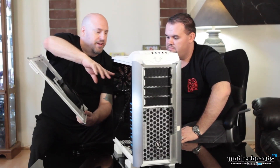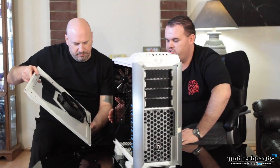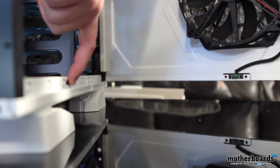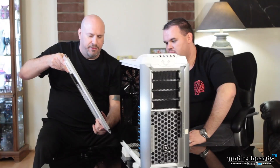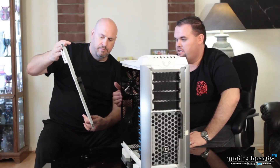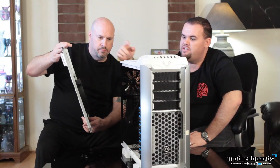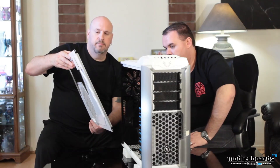That's pretty cool. So no more little wire cable running from the back of the case into the fan giving you problems. It's pre-wired contact — as soon as you close the side panel, the side fan starts going. You can see right here the contact point on the case where it makes the connection. So when you close the case door back on, you've got your fan working. Now, is this fan taking air in or air out? At its default setting it actually pulls air in. So the airflow design has two fans pulling inward — your front 200 and your side 200. The top 200 and the rear 140 are both outlets.